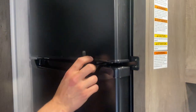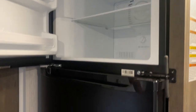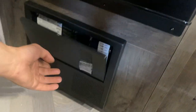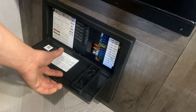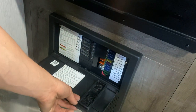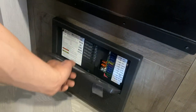Down below there's an access panel — I believe your water pump — and a 12-volt fridge. As long as you're plugged in with your batteries charged or charging, that fridge is going for you. Freezer in the top, fridge in the bottom. Below that, your converter: press the top center and it pops open. All your breakers are in the middle — whenever a breaker trips it sits in the center, so just turn it off and back on to reset. On the right side are your fuses — whenever a fuse pops you'll get a little red LED right beside it letting you know exactly which one went.